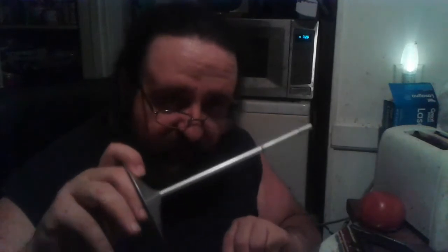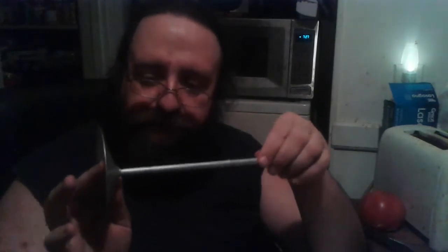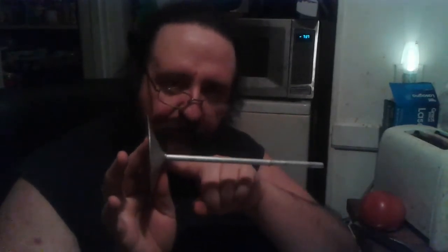Now, I mentioned that this is going to be the weak spot in any of these type of percolator pots with a big flat foot on the bottom. They make an electric perk pot with a stainless steel riser pipe where the actual foot is more like a cup, and it's welded to the riser pipe. Those prove to be a little bit stronger, and usually the pot's electrical element burns out before the foot gives way. But when you have this design, that joint right there will always be the weak spot.